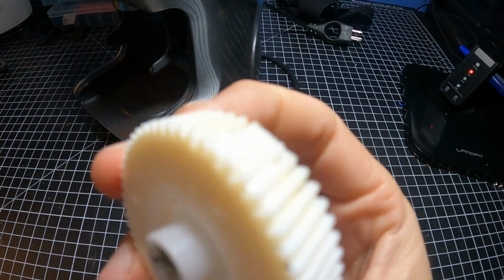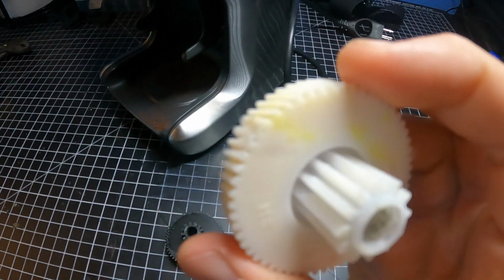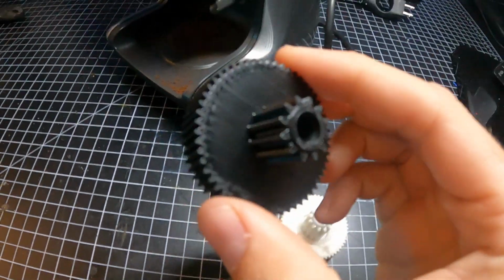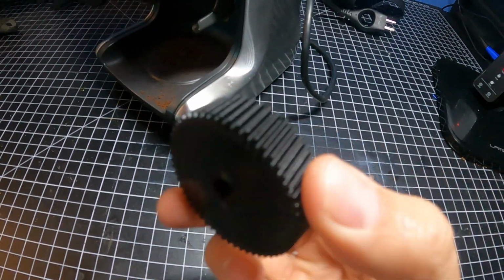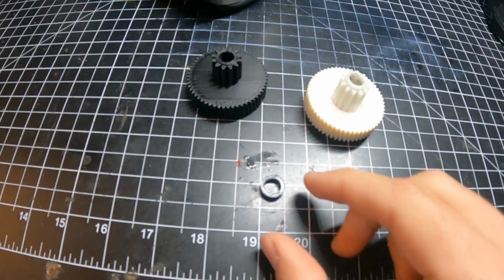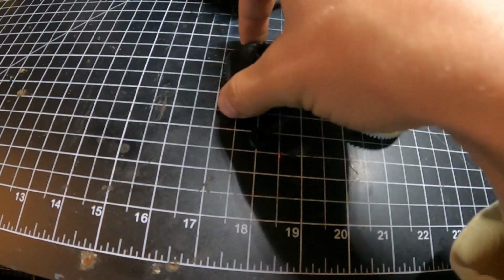So I took it apart, and lo and behold, the main drive gear here was shredded. You can see the teeth on the top of this were just flattened out and ripped off. Breville does not sell a replacement gear for this very expensive coffee grinder, and so your $200 plus coffee grinder is now just a useless brick.